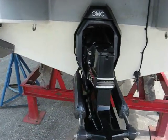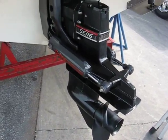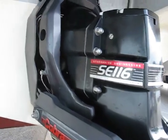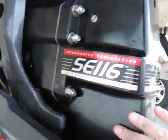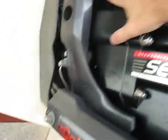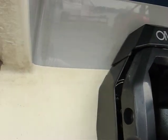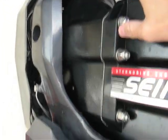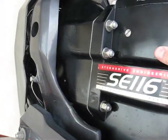Not too hard. It took a little while, but rewarding. Plus, you learn about the drive and how to adjust the shift, and you can take as long as you want to make sure it shifts smooth. This is the outdrive. This portion right here is the conversion part of the kit, and that mates to the OMC bell housing and gimbal housing.